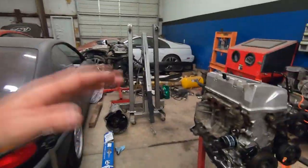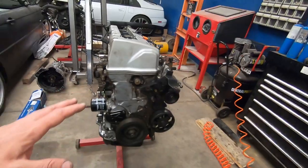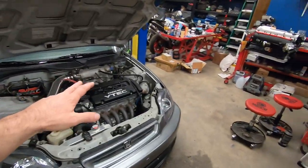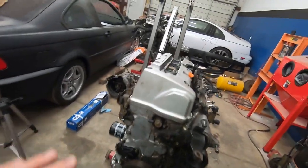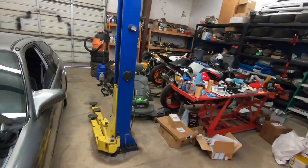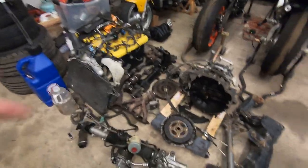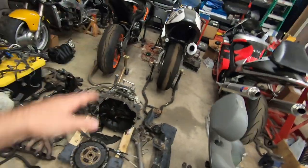We're off to a great start with this project. This engine has great compression across all four cylinders, but she is definitely grimy and in need of a deep cleaning. I'm going to go ahead and replace all gaskets and seals, and at that time I will be repainting it, making it look new — probably going with a wrinkle black on the valve cover. I definitely need to get a parts list going so I can prioritize things. The clutch kit doesn't seem to be in terrible shape, but I'm probably going to order a new clutch kit and resurface that flywheel, and I'll be cleaning the transmission and probably repainting that as well.